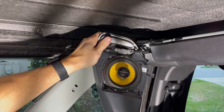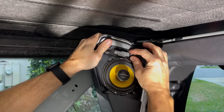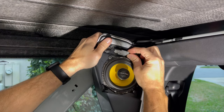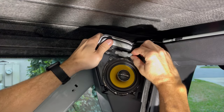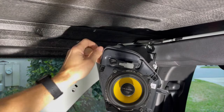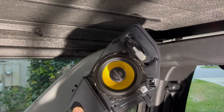We've removed the screen and got that front cover off. Now we just want to disconnect this wire. Pinch right here at the top — there's a little button — press in and simply pull that apart. That'll remove the actual four inch pod that we're going to replace.